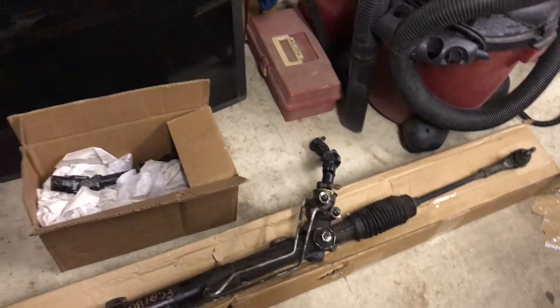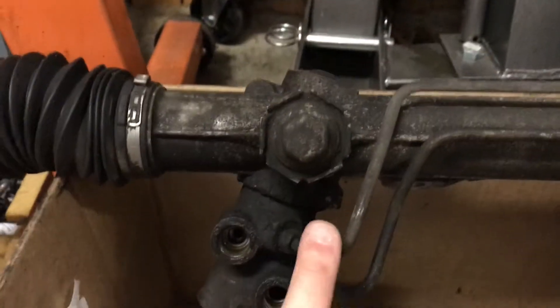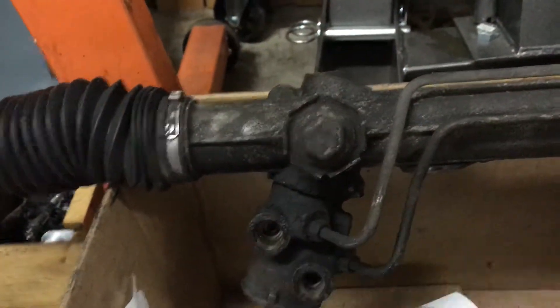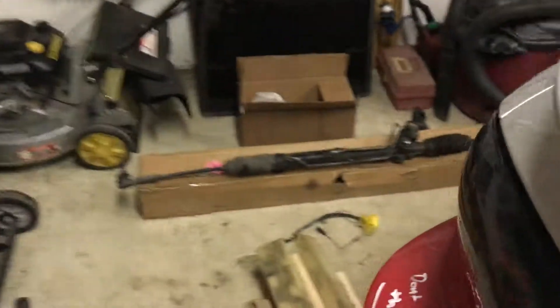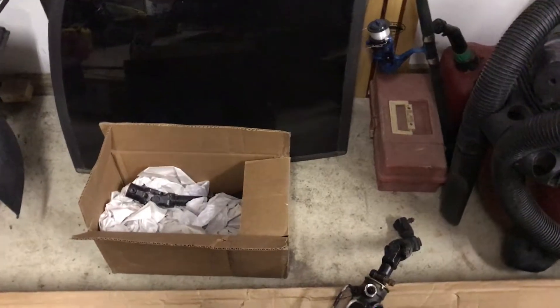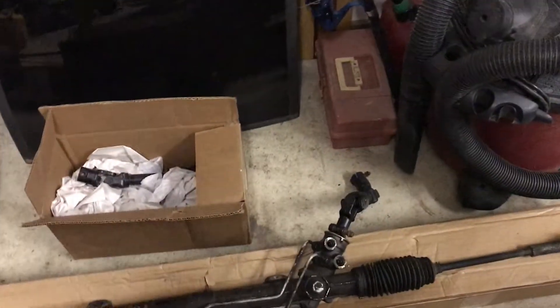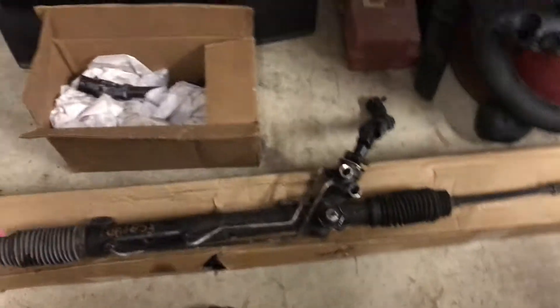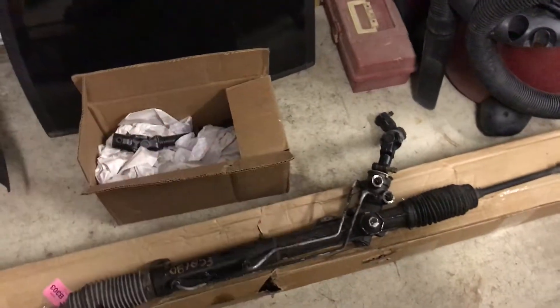The last piece: I got a rack and pinion. This came off a V6 car. I needed an LS1-style rack because the stock one that came off the car is more straight up and down — it runs into the motor mounts and headers when you hook up the steering shaft. Here's the tip: if a V6 Firebird has an RPO code of FE2, FE4, or FE7, it actually has the LS1-style steering rack. I found one off an FE4 car and also got two steering shafts — all that for $120 total. I'll sell one shaft back for $30 to $50 and put new tie rod ends on the rack.